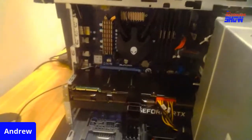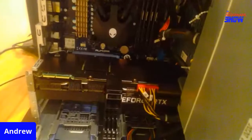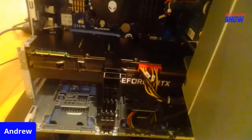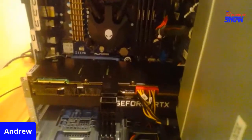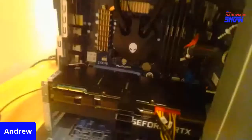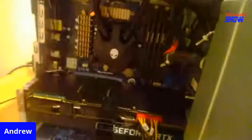For those of you listening as a podcast, I'm very sorry — it's just a monster desktop. When it's on there's a ton of RGB. One thing I really liked: the sheer number of ports on the front — three USB Type-A ports, a USB Type-C port, a headphone jack, and a separate mic jack. It intakes air through a 120mm fan in the bottom and has a hard drive up top. The power supply is in a sort of swing arm that swings in and lies flush. Inside you can see all of the parts. That's a really compact-looking 3090 — Alienware had someone create a very custom design to make it fit in a much narrower length.